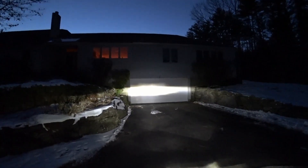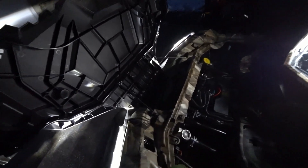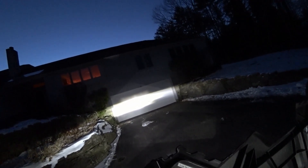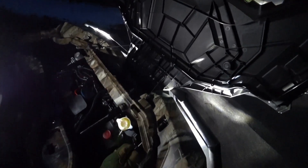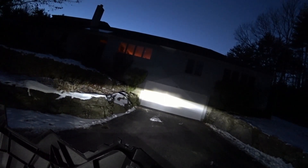You can see those are the low beams on the XP 1000, so let's adjust them just like we did on the 850. Raise the plastics and tighten this down. I'm going to aim one of them to the bottom tape mark at 32 inches. Seems good — let's go do the other side. It works better if you go underneath the plastic versus on top; there's less strain on the screw head. That one's pretty much good.